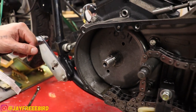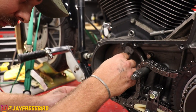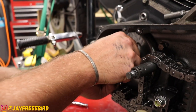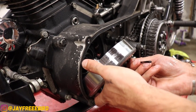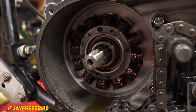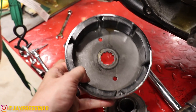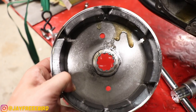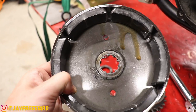You want to remember where our shims are at, so we're going to pull off the first ones. Remember the same assembly order. Now we're going to need two allen keys — put them in each hole like hooks and pull back. You're going to feel a loosen and then a tug. We are in the stator now. We got to remove the four allen head bolts inside. The hub looks good, all the magnets are together, nothing's cracked — that's a real good sign.